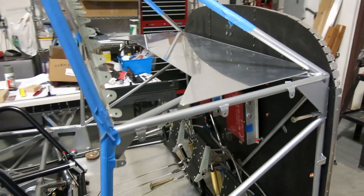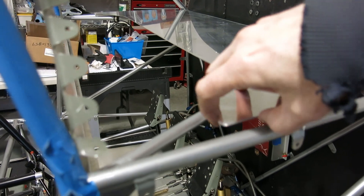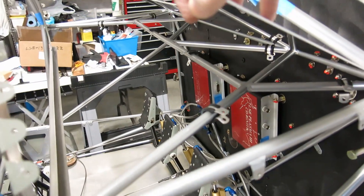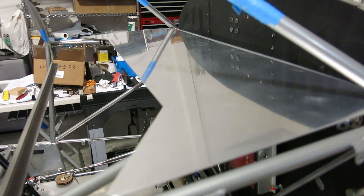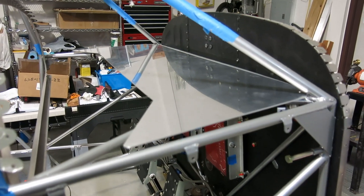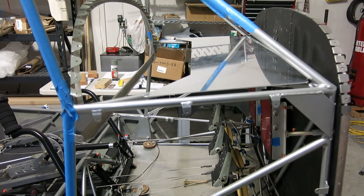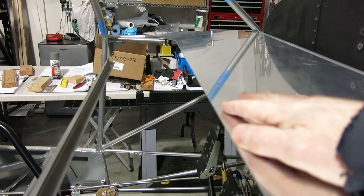Working on this shelf behind the panel. We marked it up on the underside where all that tubing lies, and we've got cushion clamps in here. We're working on figuring out where to place those cushion clamps underneath so we get a good distribution of it being clamped down. We're going to do a test fit with the panel now to make sure that everything clears this shelf here.